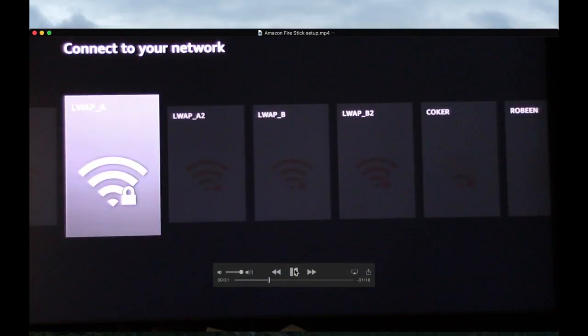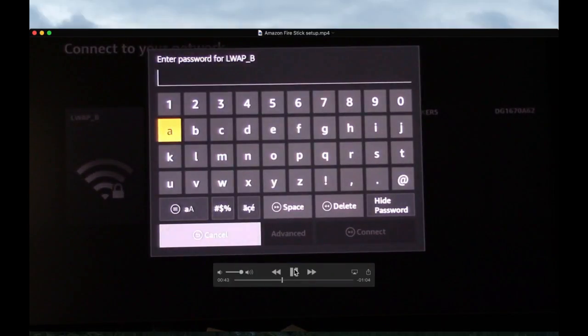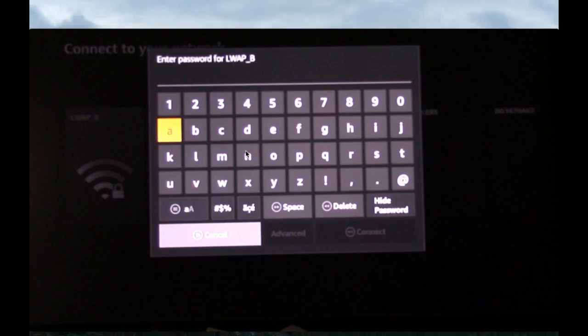Now it's scanning for networks — this is assuming a wireless situation. If you're using this at home, if you can put it on a 5 GHz based SSID, you'll have better throughput; I've done it with 2.4 GHz and it was problematic. This is where you'll enter the password for the SSID you're using, and in a hotel situation this may be a problem — you may not be able to get the password. Some hotels are using open wireless with no password, but you hit what's called a walled garden — a web portal where you have to give it something that identifies who you are, mainly by MAC address. That's going to be a challenge for this wireless stick; it doesn't have enough capability to get past it.